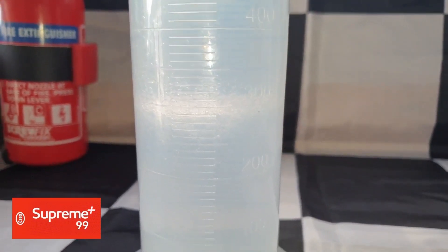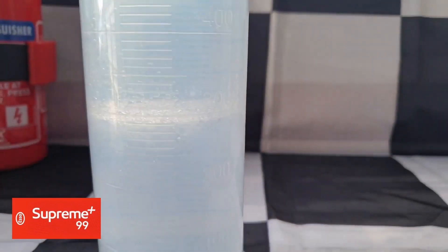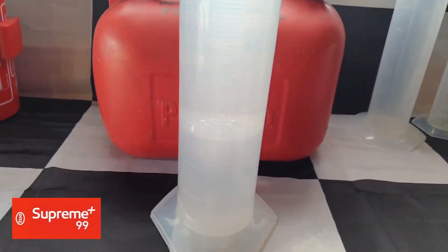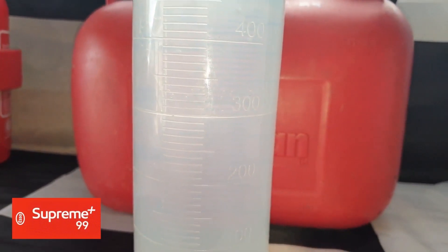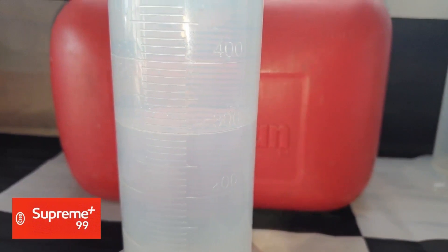This will be detailed in the next video when we have an ethanol blend, as we see the separation line as usual on the 300 millilitres mark. I'll leave it for an hour as per the previous tests, although it's never shown to make any difference even to the ethanol-containing fuels that we've tested. Back an hour later we can see no change as expected, and we can confirm that Esso Supreme is still thankfully ethanol free, at least in the south of England excluding Devon and Cornwall.